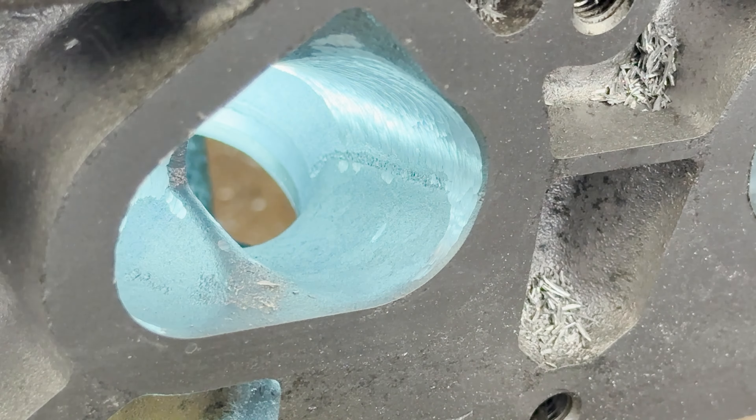It's also important to note that you should always put your finger in it. You get to learn the different shape and where you might see high spots, low spots, whatever spot you've got, and you can correct it with the burr. You don't have to just look at it — you can feel it. And once in a while you are going to get metal in your fingers. I always get metal in my fingers and I pick it out with razor blades, but this is the best way to learn how to grind. You're going to just feel it and feel the shape, and then you can make the shape.